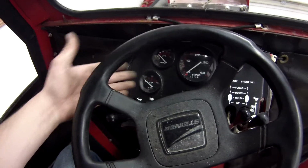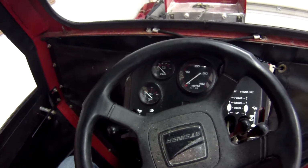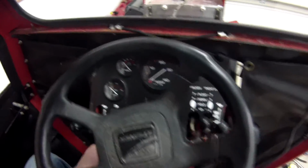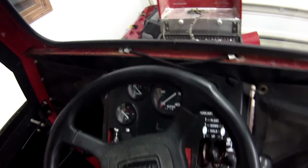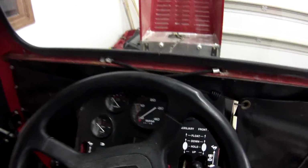Like I said, you can look down if you start to lose oil pressure. You get down around that 10 mark, something's going on, and to take a look at it. So I'm going to pull my air cleaner off here and just go over everything, make sure there's no leaks in my piping, and if I have any issues with this, I'll let you guys know. I'll comment below. Thanks.